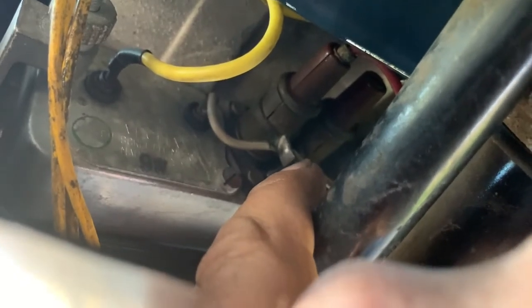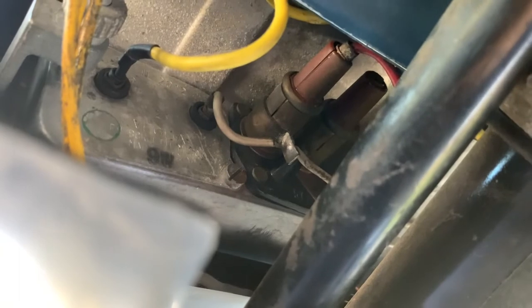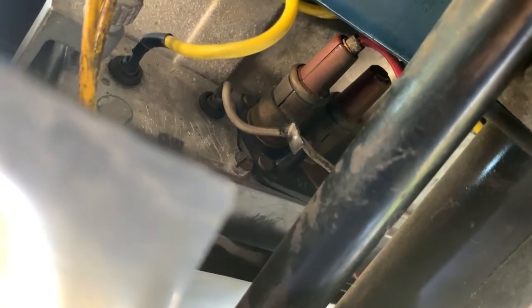So I'm gonna pull the cluster out, check for voltage back there, and start chasing the ignition switch on Fiona Fiat. Right here is a common 12 volt lead for the cluster itself. Let's see, that's the back of the gauge, that's the warning light. So that's common and has voltage when I have the key on. So I'm assuming we have bad ground back there.